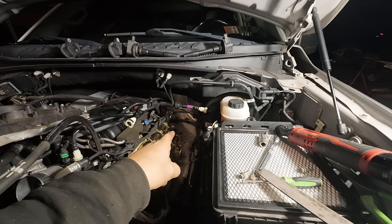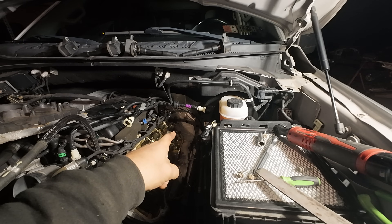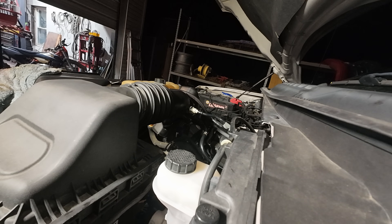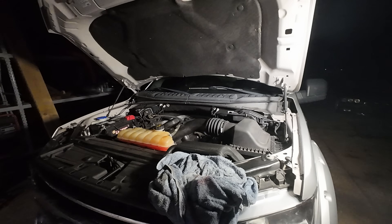We've kind of proved it with this exhaust cam. I had 148,000 miles on it when that exhaust cam developed a tap — it's got 168,000 on it now and that lobe looks better than it did when we first put it together. It may not be correct in Ford's book, it may not be correct with your shop policy, but at the end of the day, a fix is a fix. If the truck doesn't tap anymore, it runs great, and it's not tearing up the cam lobe, what more could you want? Fire this thing up and take a listen. Nice and quiet — nothing tappy in there at all. I'm going to give this thing an oil change and send it on its way.